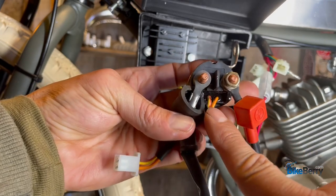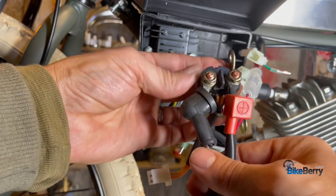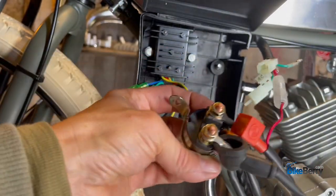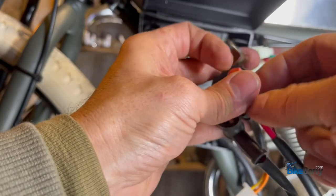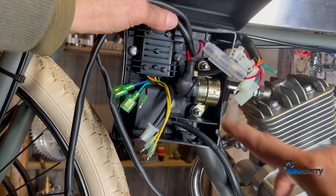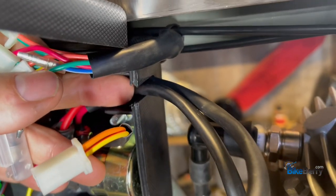Here's a good image of it — wire, red, black. So you want to view it this way, with the red hanging down and the black hanging down, because then everything's going to be sideways and your wires connect out here. Slide the boots up and over. This is directly connected to your battery — it's your relay for starting. I think they did the different boots just to differentiate the two. That's what you want it to look like. So I put the bolts back in. This thing is mounted permanently in there again. You can see the wires are pointing up, which means they can go out the slot on the side.